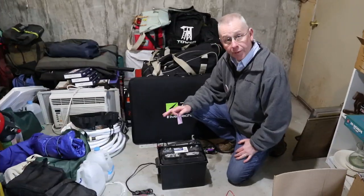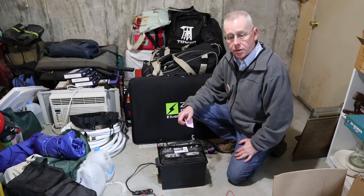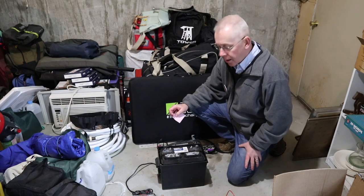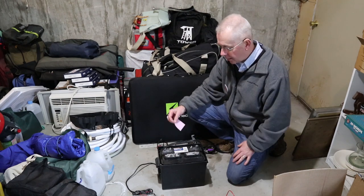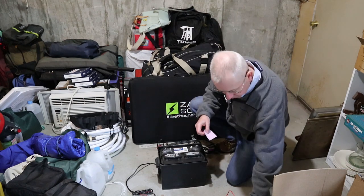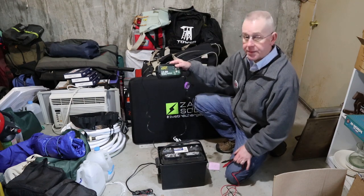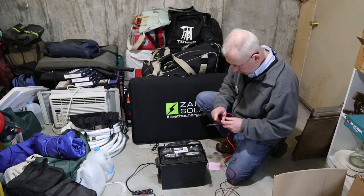All right, well, because we're filming this towards the end of the month, it's time to give our battery a little maintenance. So if you haven't checked out our little Luv Subbin short, which we did up here, I take my battery inside, I completely disconnect it, I record the voltage every month, and then once per month I top it off with my 1.25 amp battery tender plus smart charger. So we'll take a look at the voltage to see.